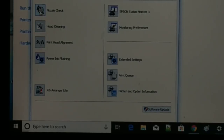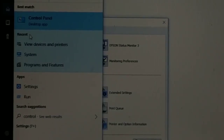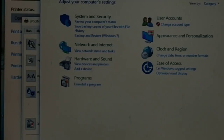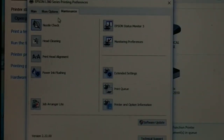For Windows 7 or Windows 8, go to Search and type 'Control Panel'. Open the Control Panel, find 'View Devices and Printers', and click on it. Right-click on your printer, select 'Printing Preferences', go to the Maintenance section, and you can access the same nozzle check and cleaning tools.